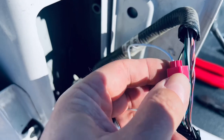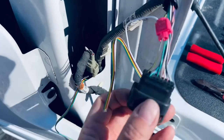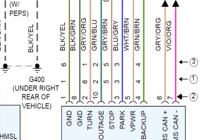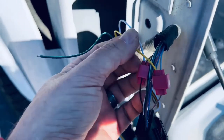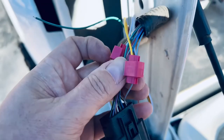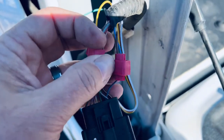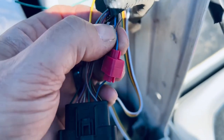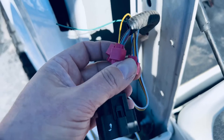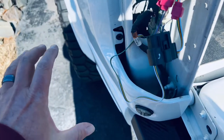We're going to connect the white wire to our black with yellow stripe — that is the ground on the 2018 Raptors. Next is yellow from the MC Tuning light to our gray with orange stripe — that is our left or driver's side turn signal wire. Third connection: brown wire of the MC Tuning assembly to the blue with gray stripe on the factory harness — that is the parking lights. When you turn your parking lights on, the running light will light up, not as bright as the brake light, but it will light up.